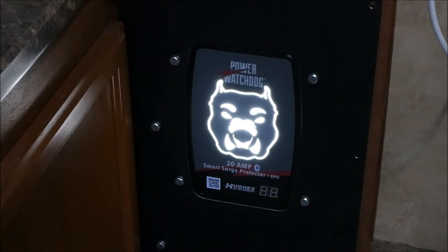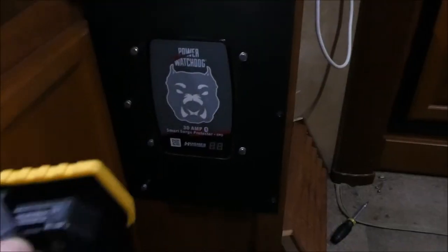If the voltage drops below 104 or goes over 132, the watchdog will shut off the RV. That's a good thing. When there's a problem, the dog's face will turn red. I think we're good to go. I'm going to finish up a few little things here. Before I put this panel on, I strain relieved that cable going to the top and this one on the bottom. I think those will stay put and the wires won't wiggle around. This is done — it's hard to see. I have to do this in the daytime tomorrow.